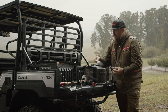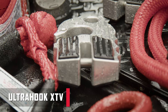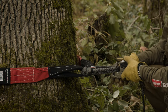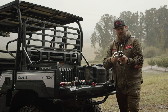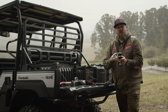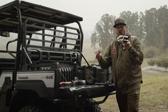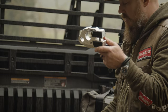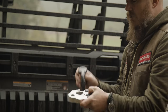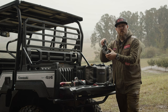Coming from the FlatLink XTV, we go all the way up to our UltraHook. The UltraHook XTV was specifically designed for off-road racing purposes where you need a quick attachment point when seconds matter. It's also found a lot more capability in the tactical world for military users and for fire departments and search and rescue worldwide. This hook has the closed system shackle mount on the end, and in the throat opening you can use a full-size three-quarter shackle and still snap it on — the only UTV winch hook in the world that interfaces with a full-size three-quarter shackle.